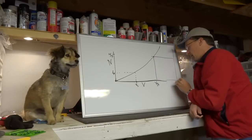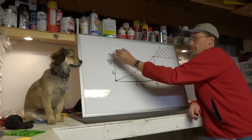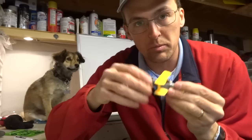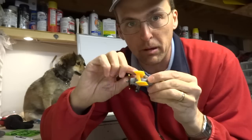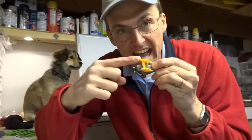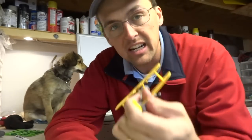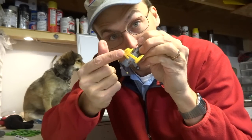Dive speed, VNE, and the speeds we're talking about are over here on the diagram. What's going on is you have enough lift to exceed the four Gs your structure is designed for — this area is the dangerous area. The faster you go, the more lift is available to break the wing. When we say breaking the wing, we're not talking about drag loads crushing the wing; we're talking about lift bending the wing up. The problem isn't going so fast that the air crumples the wing in drag. The problem is that there's so much residual lift that a gust or a small pilot mistake can create enough angle of attack to generate enough lift that the wing breaks.